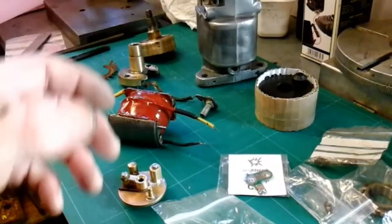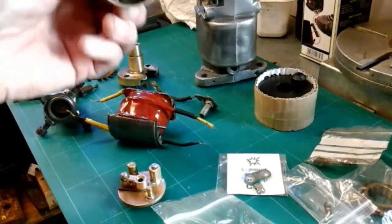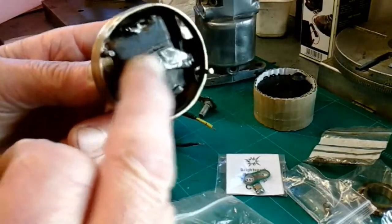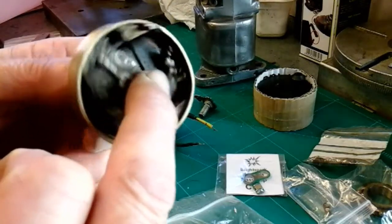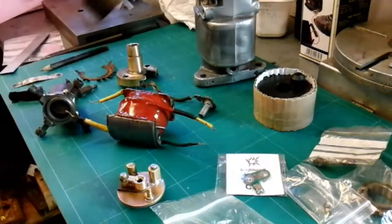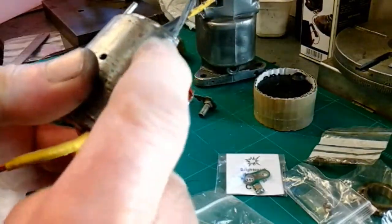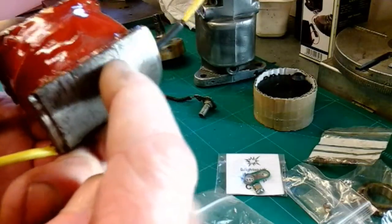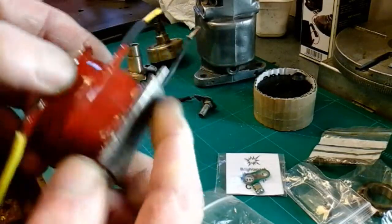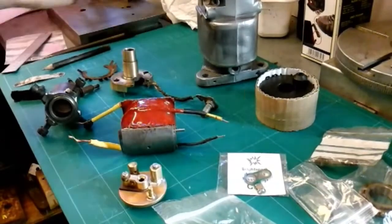I won't be putting one in the back of the points. I'll just show you that condenser — that's in the back. I shall be leaving that condenser in because I think by taking it out, it's removing quite a big lump of material and it might make my magneto out of balance. I'm not sure if they balance these up, but if you look on this armature it looks as though there's bits of turning where they've took grooves out on the edge — whether that was to balance it or just how it was made originally, I don't know. So I shall be leaving that in.